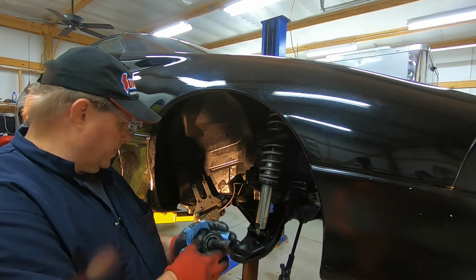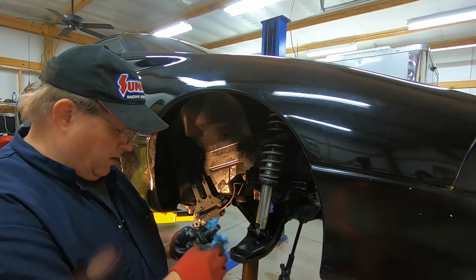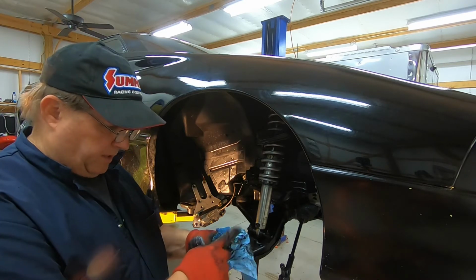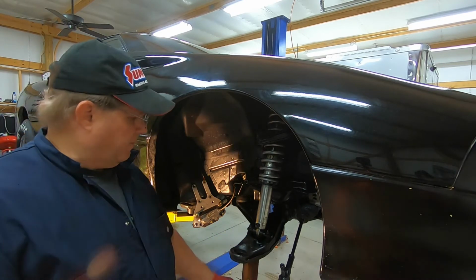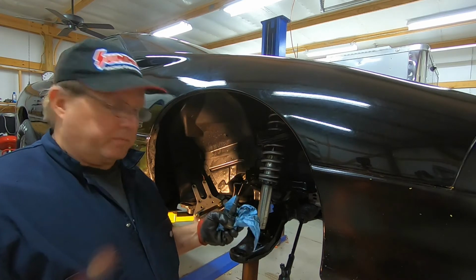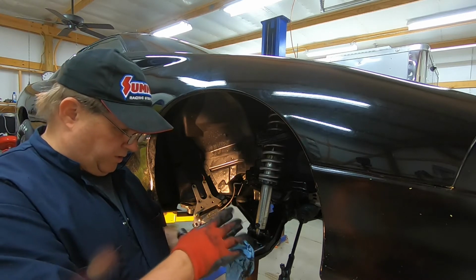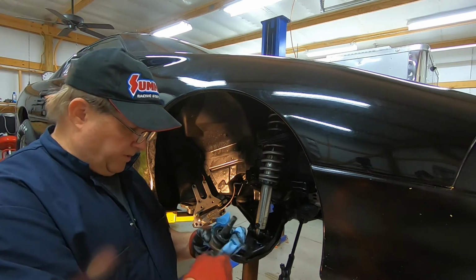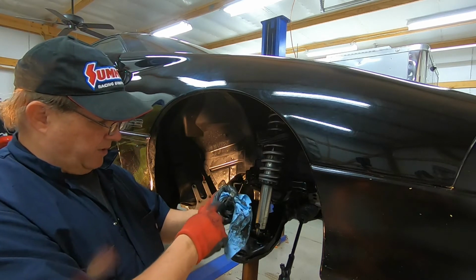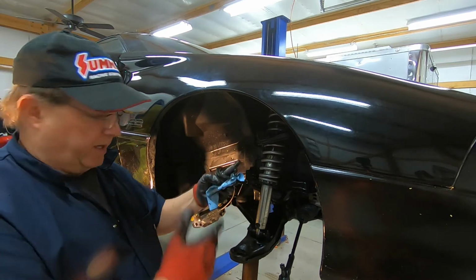I didn't have the video running at the time because I was beating on this thing for a while. What I was doing, I think, was wrong. I was beating on this thing pretty hard. I didn't have a backer on it, something to put pressure up against the arm. So that was problem number one. The other one, I kept beating on this and, for some reason, it just was not coming out. I ripped off the boot, the rubber part around this. Then I beat on the side, or just moved this around and took the hammer around the side, and it popped right out.